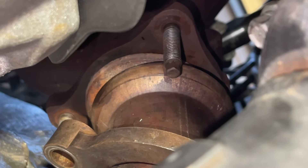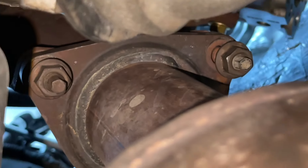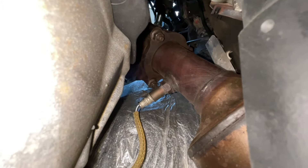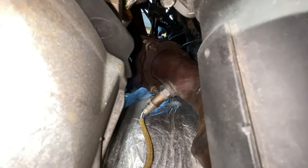That flange goes on the exhaust manifold side, so make sure it's in place before you lift the exhaust into place or it can fall out. Putting the exhaust back on the passenger side — this side is fixed so line it up first. Sometimes you have to put your foot on the muffler and push it back as it can get hung up. The other side is more of a collar, so move that one into place and use 15 millimeter nuts. Get all the nuts on loosely first, then push up and tighten evenly.